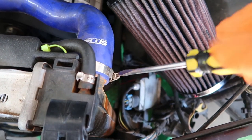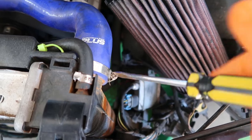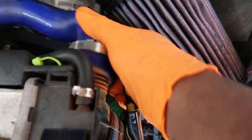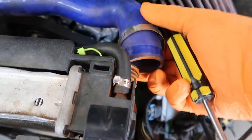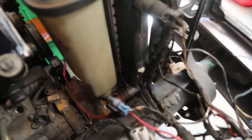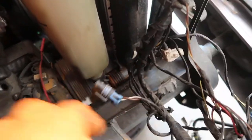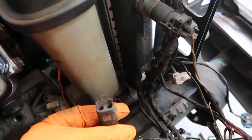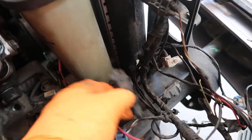Okay, so now that while it's draining out the water that's in it, go ahead and remove this clamp. I'm gonna remove both hoses just to get all the spaces that I can. Yeah, that's just pure water in there. That's crazy. Okay, so we got the low radiator hose off. The clip for the coolant level sensor off. And then the upper radiator is off, still dripping a little bit, so we're just leaving the pans down there.